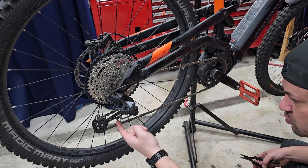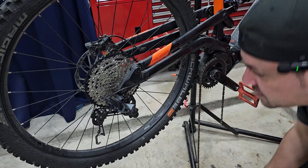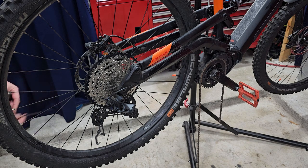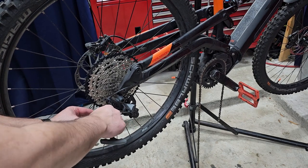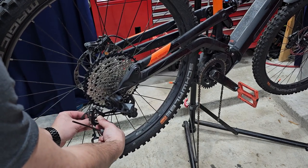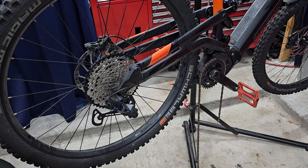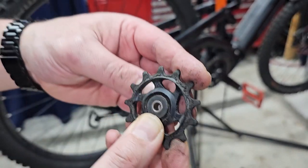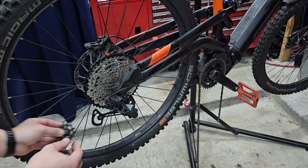The first thing I want to do is remove the chain to get it out of the way from the rear derailleur. There are two Allen heads — I believe they're three or four millimeters on the back. The reason you want to take off the chain is because otherwise the jockey wheel comes with it and it'll fall off if you don't. Don't forget about the washers — there's one on each side. And there's also a little piece of tube that goes in the jockey wheel.